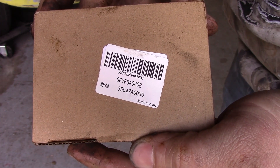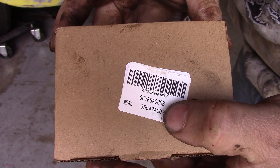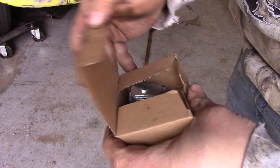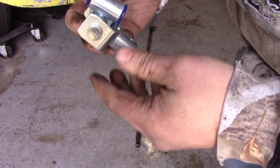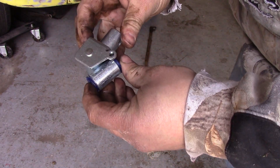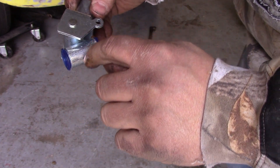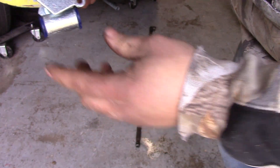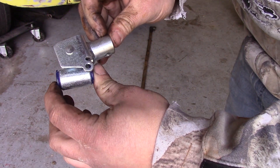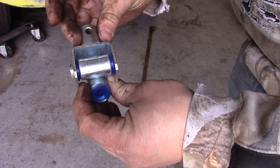Here's the Subaru shift coupler. I think it's this part number right here on the bottom that I used — it was like 25 or 30 bucks. I kind of saw it online on the Subaru Gears website. They're suggesting to cut this at an angle so it can rotate to a 90 degree angle. Right now it can't, so that's something we're going to have to do.